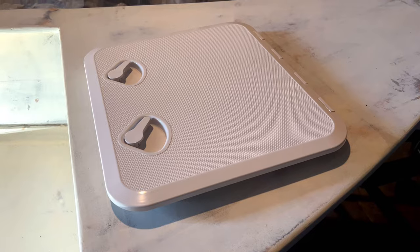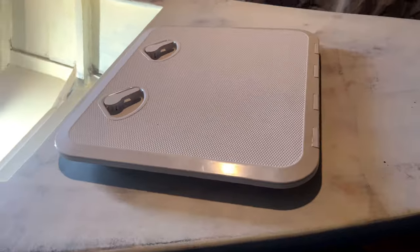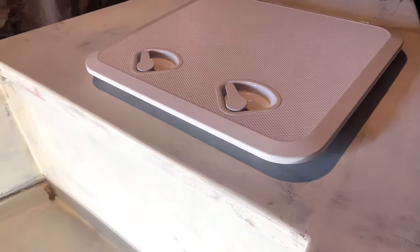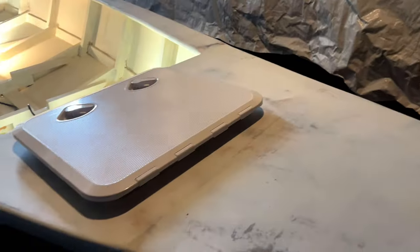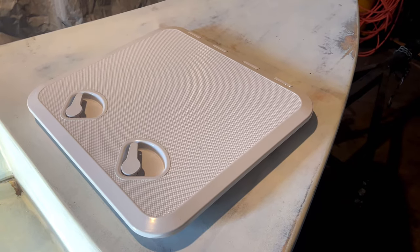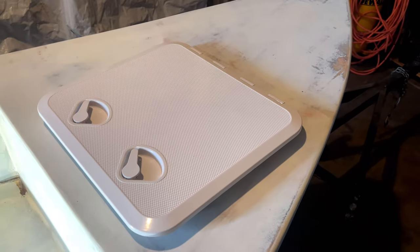All right, here I've got a plastic hatch. It's made by Seaflow. I'm sure that's Chinese for hatch. It's not going to get a whole lot of foot traffic, so I'm not too concerned about the overall durability as long as it lasts. It's 18 by 24 inches. I've got it set back far enough to clear the lumber. I'm going to cut the hole. It's an easy outline to follow. I've got it offset to the starboard side because the port side is where the trolling motor is going to be lying, all the way up to the bow there. And I'm kind of doing this backwards, but I'm going to cut the hole and build the compartment inside before I fill it with foam. I probably should have built the compartment inside before I put this cap on it, but that's the way things went.